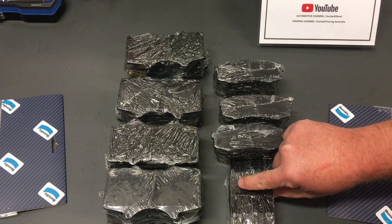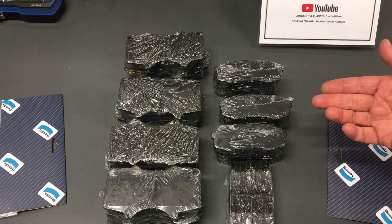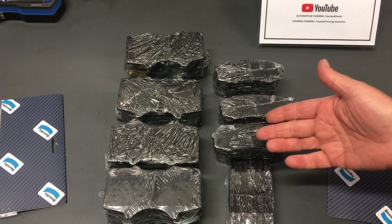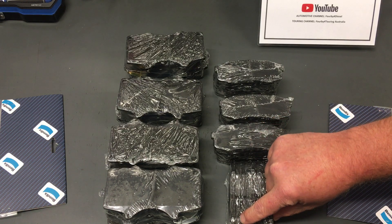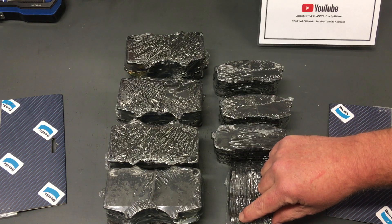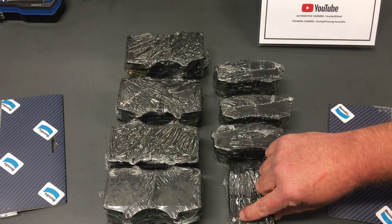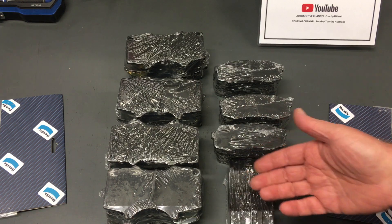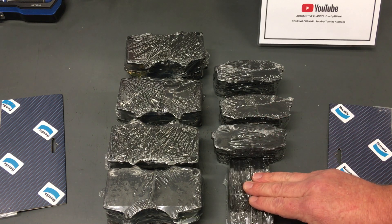The problem you've got is: once you get down to whatever amount you estimate — say you've got 8mm, you put them in at 100,000km and at 120,000 you've got 6mm — you're going to be down to the metal. Roughly a millimetre every 10,000km. In two services, 20 or 30,000km, you use 3mm. They're going to last to the metal at 80,000km, but you're replacing them when there's a couple of mil left because they're worn on an angle. Maybe you're only going to get 40,000 to 50,000km out of them.